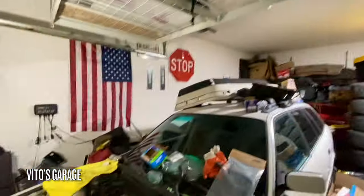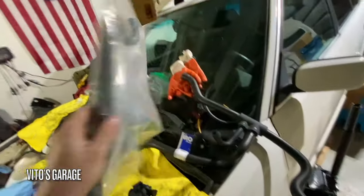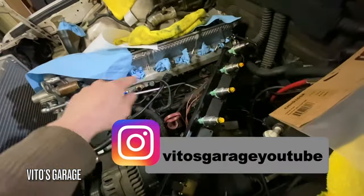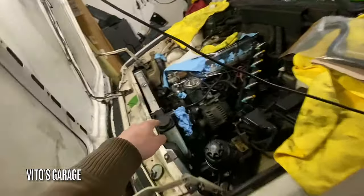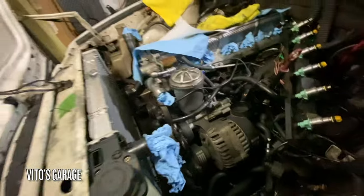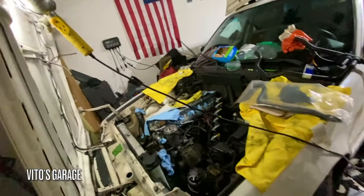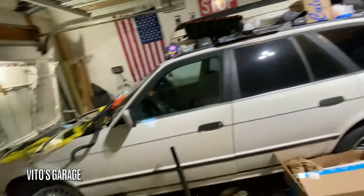Another day, and today we are going to be finishing this project. We have some new coolant hoses that we decided to replace, which is a good thing to do. This big one gets neglected — it runs under the intake manifold. Then I'm going to be putting the cooling hoses back on, reconnecting the banjo hose for the VANOS assembly, the fan, and then the intake manifold, valve cover gasket, and valve cover. We're basically almost done, guys. It's been an amazing journey — can't wait to hear this car running.